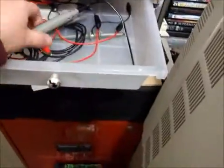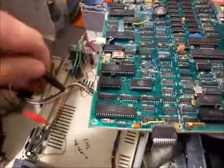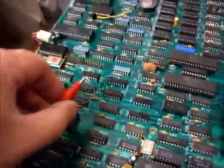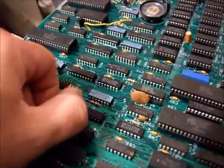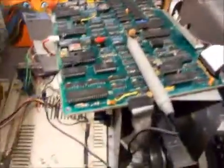For those who are going to stay with me, I'll show you how we fix this problem. The first thing I do is grab a logic probe. Turn the machine off, connect the logic probe to ground and to 5 volts — I pick up 5 volts from the video expansion connector; pin 34 is a good source of 5 volts. Then we fire the system up again.